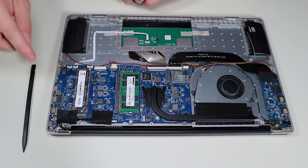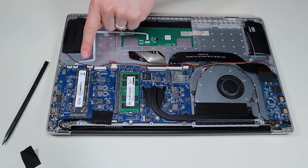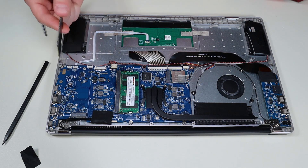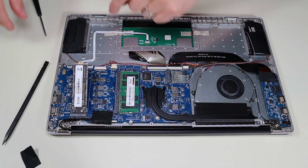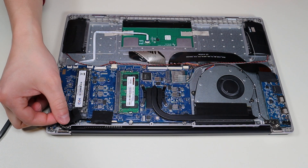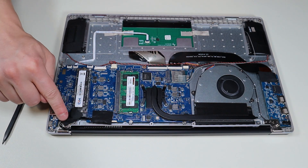In order to get that out, there's a piece of tape right here so we'll just go ahead and gently take that off. Put that to the side — there's a single screw down here. Remove that single screw, the solid-state drive releases, and then you can slide it very easily out of that port. To install one you would just slide it back into that port, make sure it's nice and flush and straight, then bring that screw back over and carefully screw it back in to secure it in place. I'm also going to make sure to put this piece of tape back down because it holds the LCD cable away from that screw threading so that it doesn't pinch.